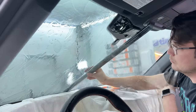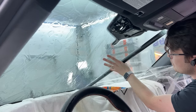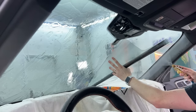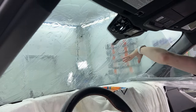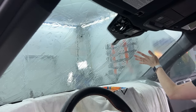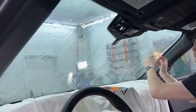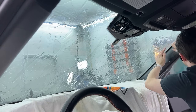This is a windshield I did in 50% ceramic. We pulled the liner and then it helps basically unroll once most of the film is supported onto the glass and things are kind of in place. The more room you have to work with on the inside of the windshield, the easier this is — so when you're doing something like an Audi you're going to have a much harder time. At that point I let the film drop, pull the rest of the liner, let the entire thing hang, tuck up the film that's bowed up there, and get the entire thing to lay flat against the windshield. Being that it's 50%, it's easy to miss a corner or leave a little light gap.